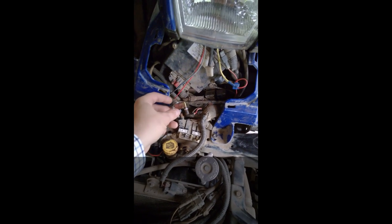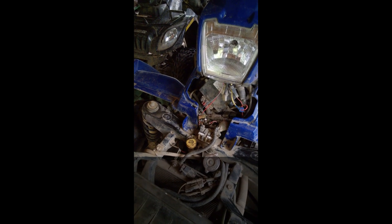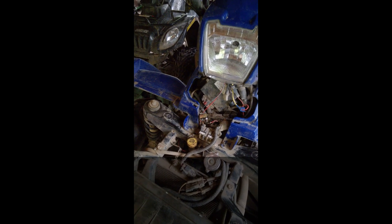I've replaced the circuit breaker with a new one I got off Amazon. The fan has started up once already — I'm just waiting for a couple more cycles. What was happening in the past is it would run fine a couple of times, but once I got the machine really warmed up the circuit breaker was starting to fail. You could hear the fan kind of surging — starting and stopping, starting and stopping, never getting up to full speed.